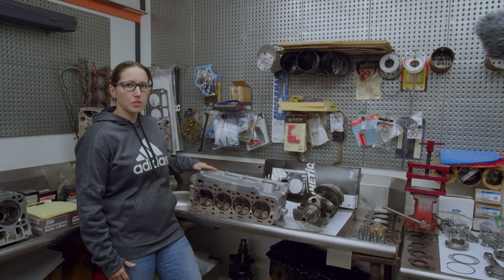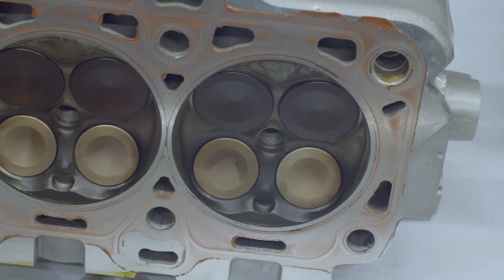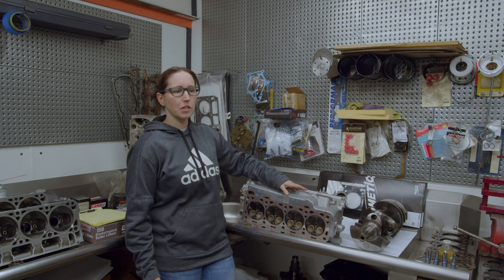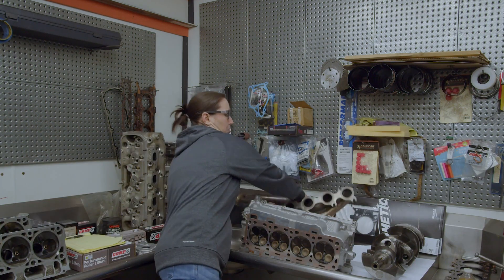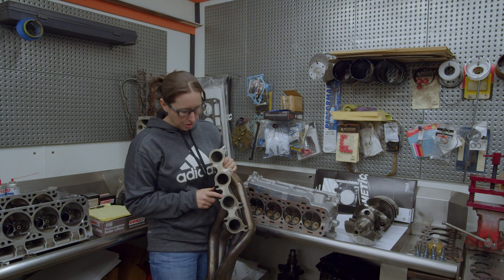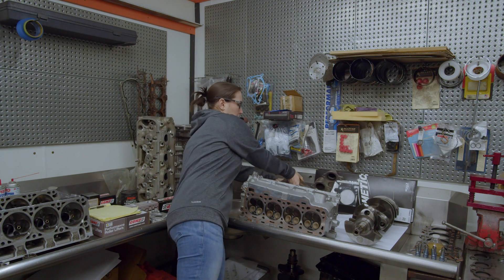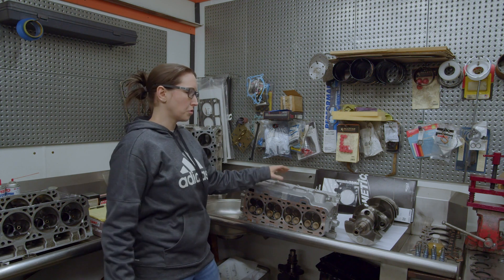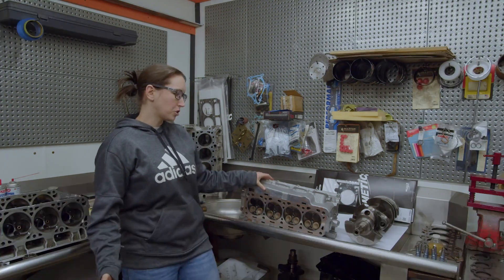When you pull the cylinder heads off, check the chamber and the valves — sometimes based on the color of the valves you can tell things about the tune. Check the intake ports; sometimes you can see differences bank to bank or cylinder to cylinder, especially on ethanol and E85. Also look at the exhaust ports to see if one is richer than the other. Even with headers, you can tell what each chamber is doing and adjust your tune cylinder to cylinder, which matters in hardcore racing.